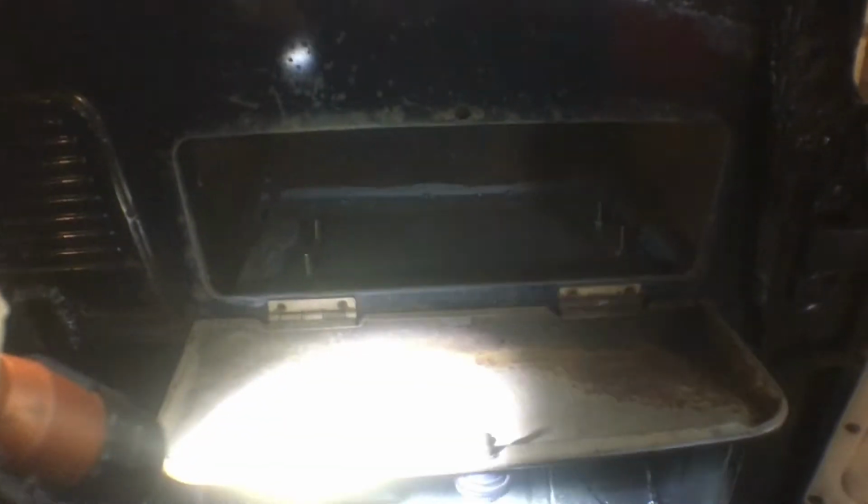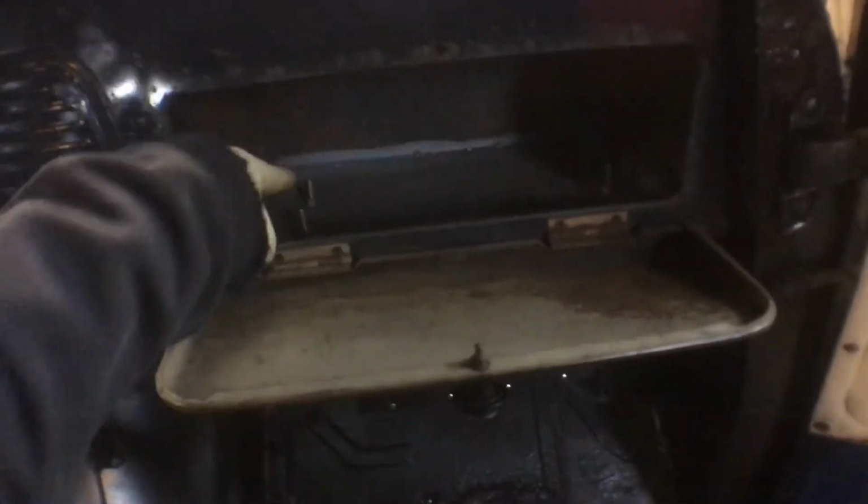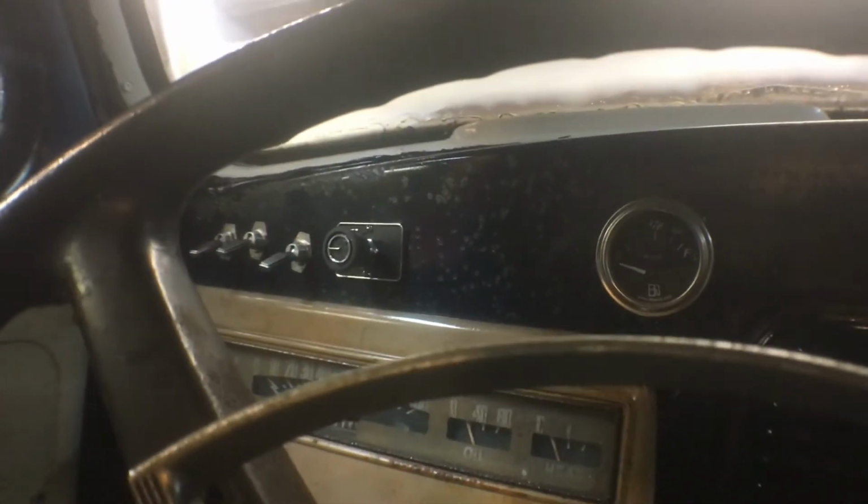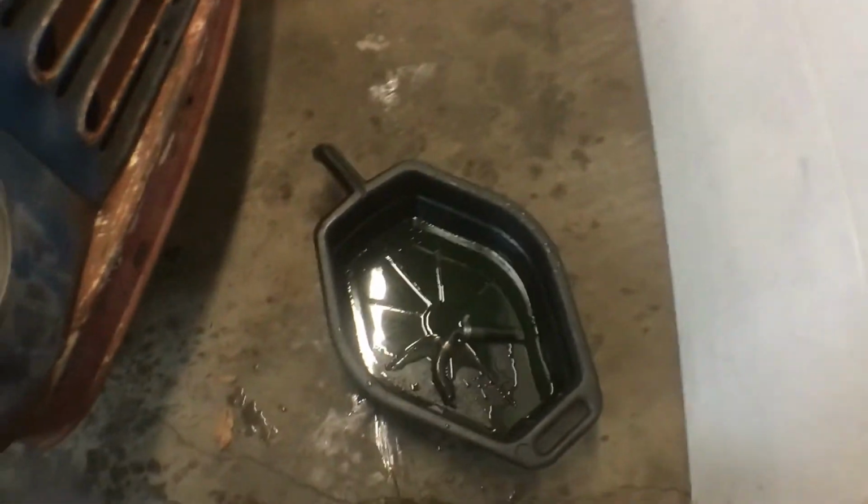Heater's mounted. I just got these bolts hanging in there. I can go with a shorter one eventually, but I might build a bracket off these bolts to hold a radio inside here, so I think I'm gonna leave them for now. We got the hoses through there. I drilled a hole for the switch and mounted it, and got the hoses ran, and they're hose clamped onto there, and we didn't lose too much coolant, so that's not too bad.